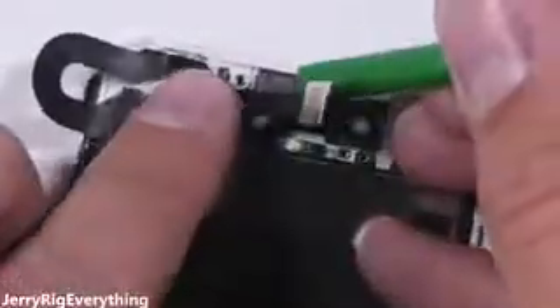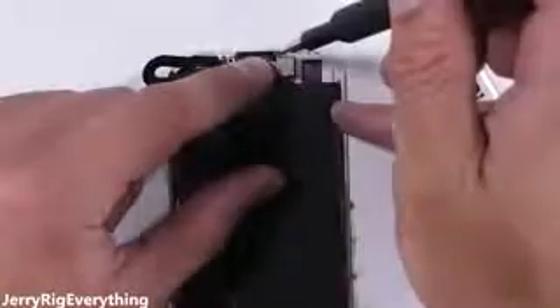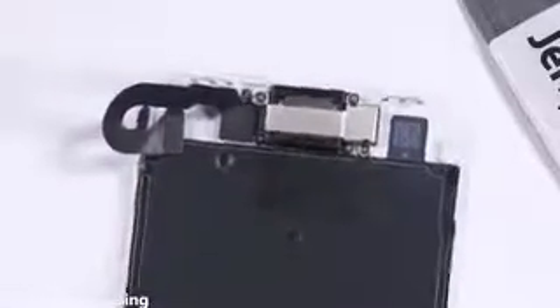Once the home button is in place, we go up to the top for the accordion-like sensor array ribbon. I'll start with the rightmost box sensor, plop it into the square hole, and then fold the whole thing over to the left, lining everything back up with the grooves it came from. The golden circular pads at the bottom that give signal to the speaker line up with the two pins to keep them in the correct location. The top speaker gets put down before the camera and screwed in with the bottom two screws, then the camera itself gets folded over the top of the speaker and set down into the circular hole it came from. The middle bracket with its three screws holds everything down — it should fit naturally and won't need to be forced into place if you've origami'd everything into the correct position.